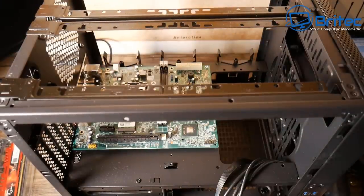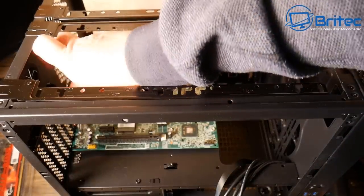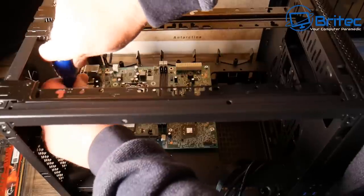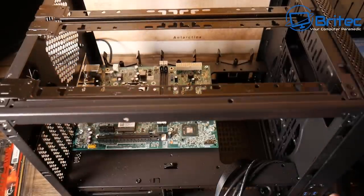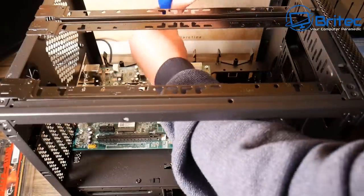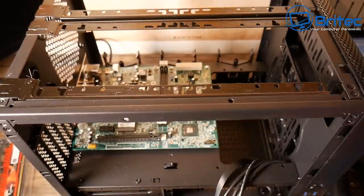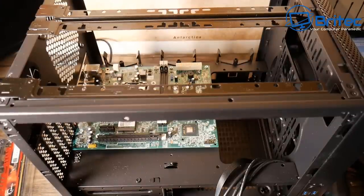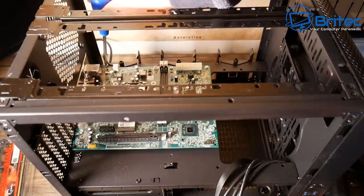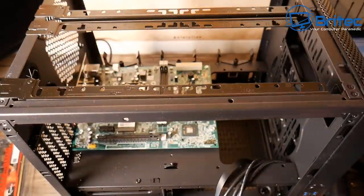You can already see this gives us much more scope — full access to the PCIe slot for bigger graphics cards. One thing to watch out for: the power delivery through those PCIe slots is sometimes only 35 watts, which can cause stuttering. Do your research and watch someone else's video to confirm a graphics card works in your specific Dell build — whether it's a Dell Optiplex 7010 or a Dell Vostro — before buying.